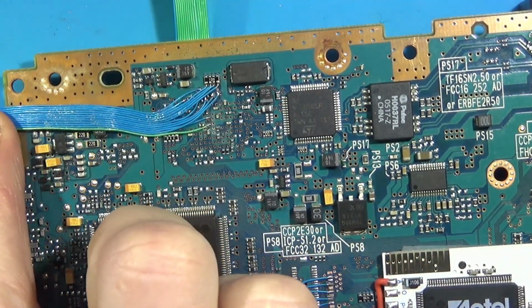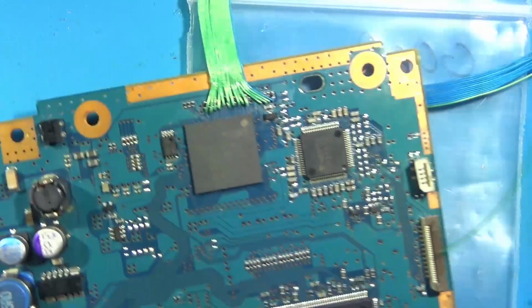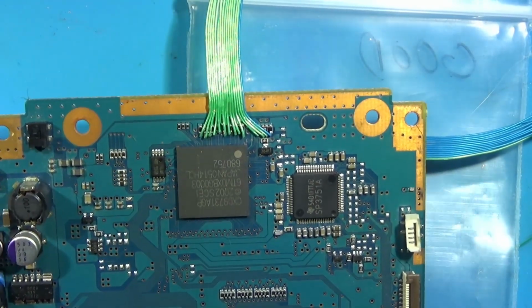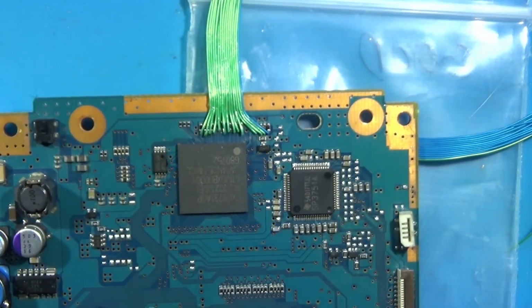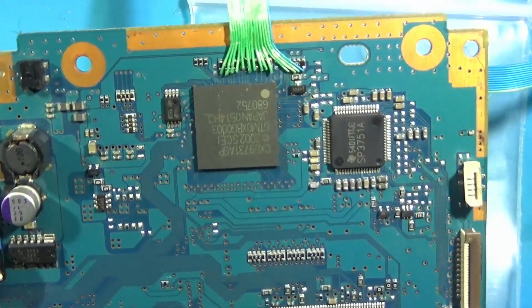This is the easy part. The hard part really is wiring it to the IDE port, because it's just a lot of 2, 4, 6, 8, 10, not everything's numbered, and it's 44 pins, so a lot of counting. It's going to be a real Sesame Street affair wiring this up, but overall, I think this looks quite nice. And we're not going to see it once it's installed, but it does help to have the cables nicely managed like this, for sure. So, last thing on the docket here is wire it up and hope that it works. So let's get to that.